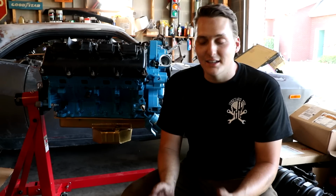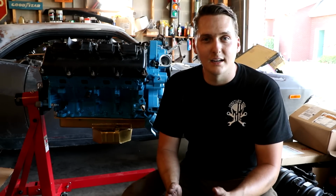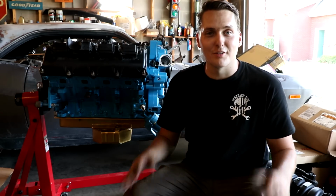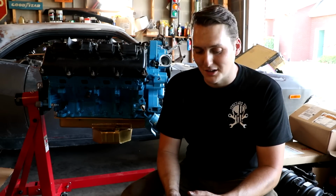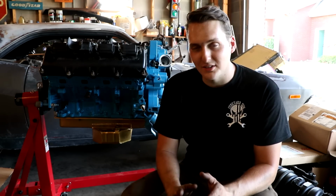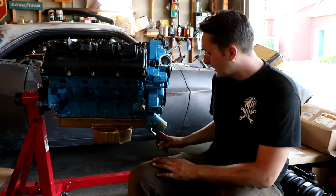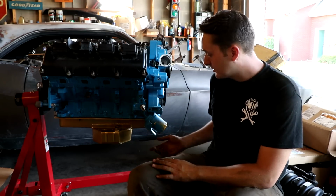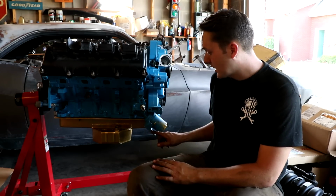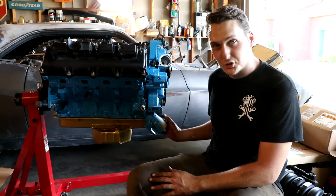I just hate that the engine didn't get put in, so I apologize for that. I really was looking forward to letting you guys see that, and have that victory finally, to see the engine in the car after all this time, but it just did not happen this video. The next time though, we are going to have this engine sorted out. We have to get the pan, and then we're going to have to make a little modification right here to the oil adapter. We can make this work. We might just have to cut this off instead of having a remote filter. We'll just cut it off right here and then get a really short filter.